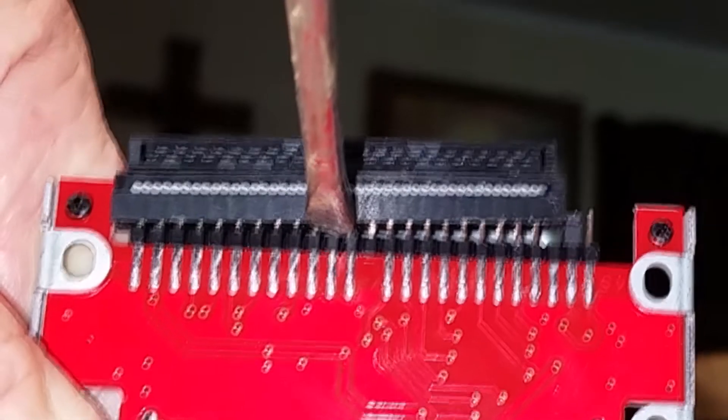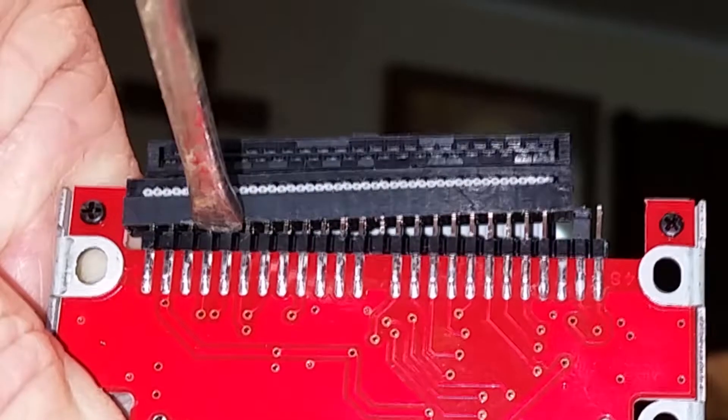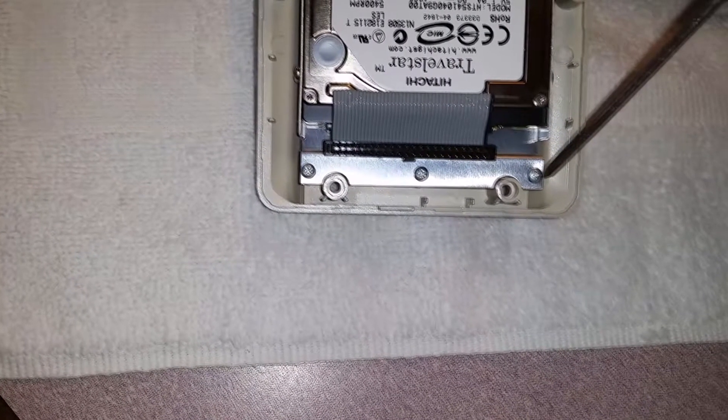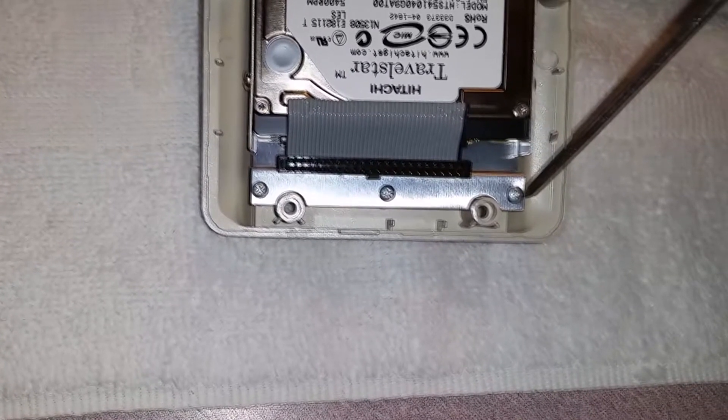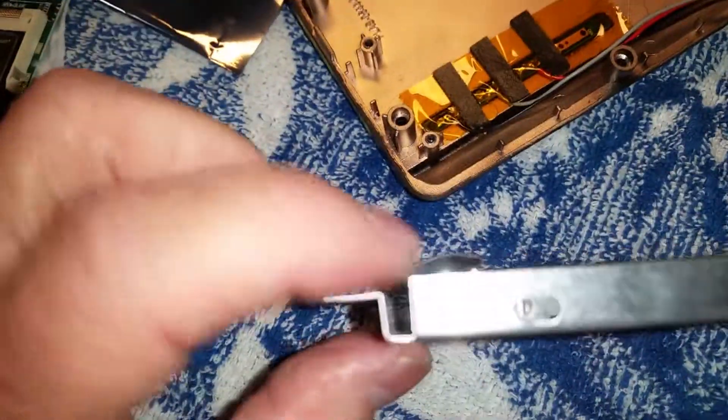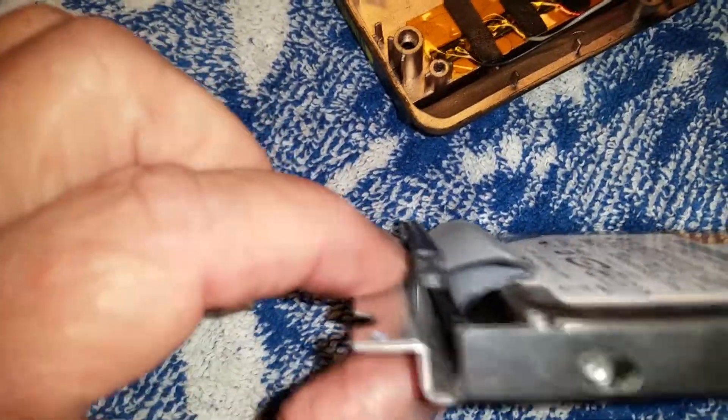Very little twisting pressure is needed. A clearer example will be shown as a guide to removing it. Once the ribbon header is separated from the main board, slowly start lifting the battery compartment up. Be sure to unplug the red clip on the battery cable before turning the battery compartment over. Pay very close attention to how the right side of the ribbon has a black stripe — remember this, write it down or take a picture. Remove the screws holding the drive bay into the battery housing half, making note of exactly how forward the upward-turned ribbon header aligns with the channel in the drive bay. Then remove the screws holding the old drive into the bay.